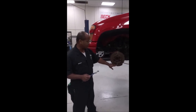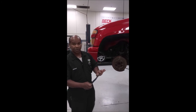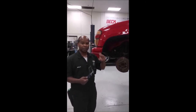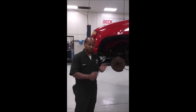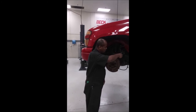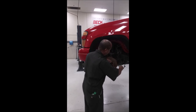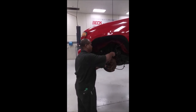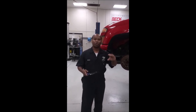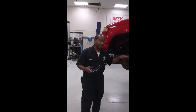I've put markings here and here — we're going to measure in six different locations using this micrometer. We're going to subtract the difference from the highest point to the lowest point, and that gives you your variation of thickness. This micrometer has already been zeroed. We'll start measuring from this side, get this location, then rotate to the other side. From the highest point to the lowest point, subtract the difference — that is your total variation of thickness. You then cross-reference that in your technical manual to see if the rotor is still within specs.